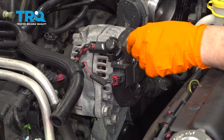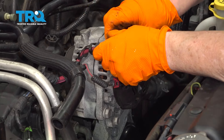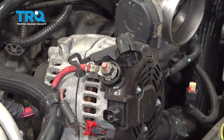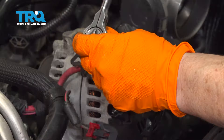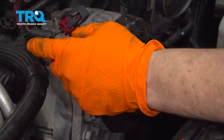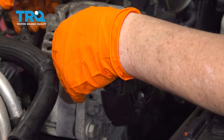Now I'm going to unplug the alternator power source. There's a little cover over the positive terminal. Move that aside and there's a red lock — that's a safety lock. Push that up to free the tab, squeeze and pull that off. Then get a 13mm socket and take that nut off. I like to put the nut right back on and set this aside.